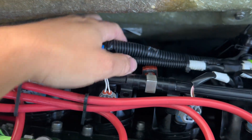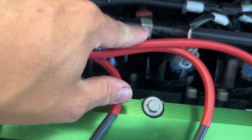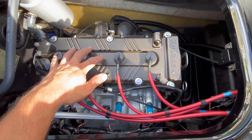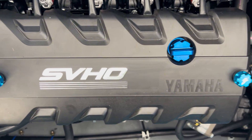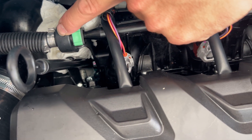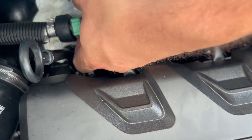On the Kawasaki Ultra 310, this is your connection to the fuel rail right here. I have this upgraded Kawi Performance stainless steel block here. You might have the factory plastic one, but they disconnect the same way. For your naturally aspirated Kawasaki four-strokes, the process is exactly the same. This Kawi Performance gauge also fits on the Yamaha SVHO and HO engines. Here's your fuel rail damper — this clip is exactly the same as the Kawasaki clip, just green instead of red.